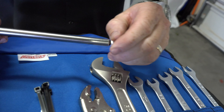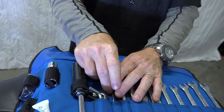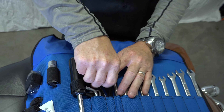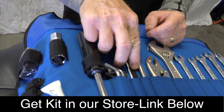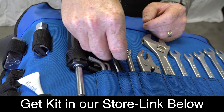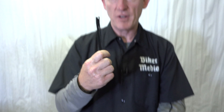This is a tire pressure gauge — nice to have. This is mechanics wire, and I have used this in the past to replace a cotter pin; it can get you by in a pinch to get back into town to get the official part. Zip ties are also super, super handy. Recently in Canada, one of the guys — Popeye — lost his shift linkage; it broke. We were able to zip tie his shift linkage back on until we could get to a nearby town and get the replacement.